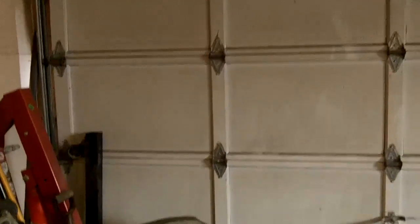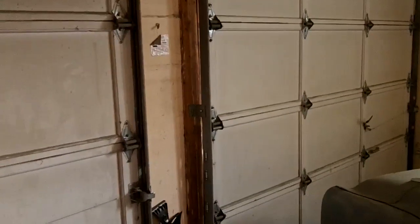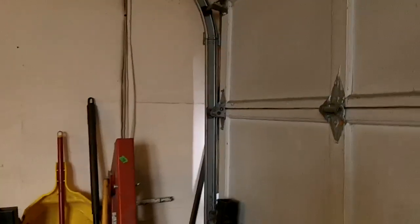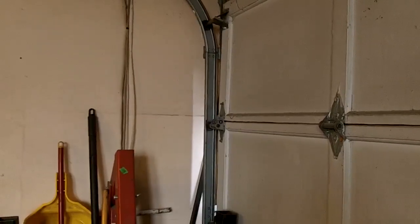Basically all I do is insulate along the edges. The door on the right-hand side of the house, looking from the front, will be closed for the winter, so I can pretty much pack the insulation in here along the top and cut some of those drafts out. The left side I like to keep available to open if required, so I'll pack insulation loosely there. You can see the gaps here and how drafty it can be — on this side you can actually see light streaming through.